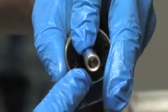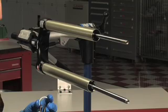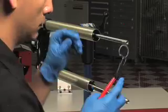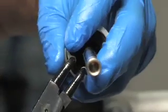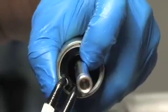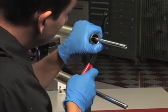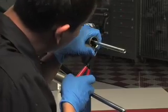Insert the lubricated air piston into the bottom of the upper tube and slide the lower air piston and sleeve assembly into the upper tube. Seat the shaft guide ring and wavy washer into the upper tube step. Then slide the negative air sleeve into the upper tube and seat the shaft guide base into the upper tube step. Secure the retaining ring into the upper tube retaining ring groove using internal snap ring pliers. Position the retaining ring holes around the retaining ring positioner on the base plate. Verify that the retaining ring is secure in the upper tube.